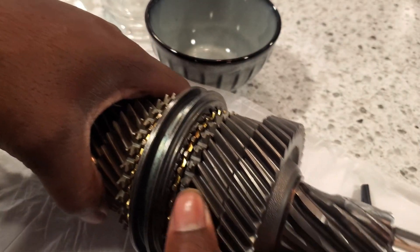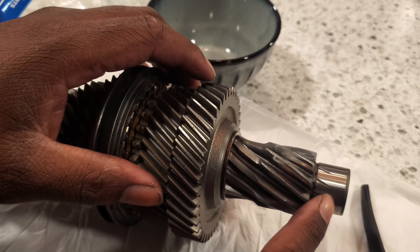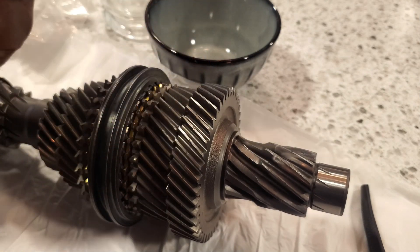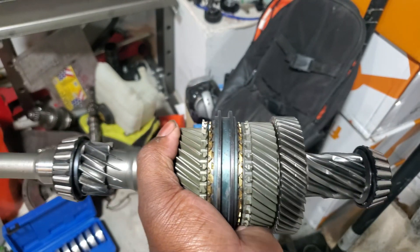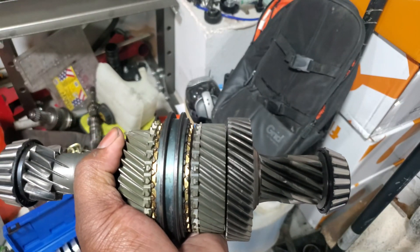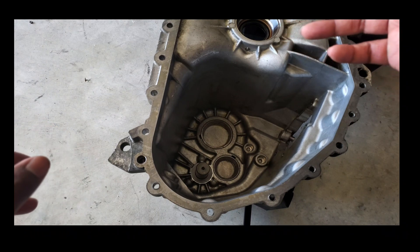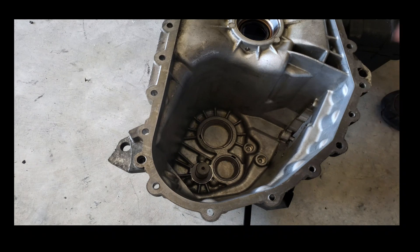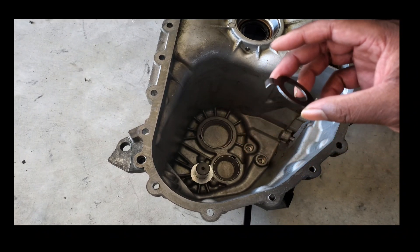We're good — there's that. Now the last part is putting down this bit, the 7025B. We have a completed 3.82 gear ratio input shaft ready to be reassembled into a transmission. So we're going to begin the reassembly of the transmission right now, and the first thing I already have in here is this clip — one of the two retaining clips needed for the reverse idler gear.